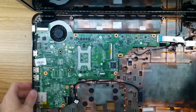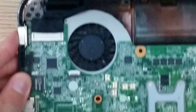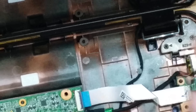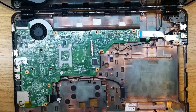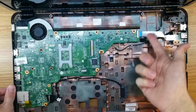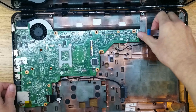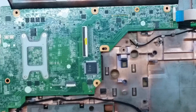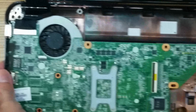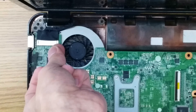Now inside we're going to remove the display to make it easier. As you can see, it's really wobbling. There are four screws, two on each side. Before we remove those screws, we're going to disconnect the display and un-route the wireless antennas. Starting with the wireless antennas — they're underneath these two connectors, so we're going to remove those anyway. Just like the keyboard connectors, lift the black tab up, pull out, and push it down. On this side, get underneath there with your fingernail and try to get it out.